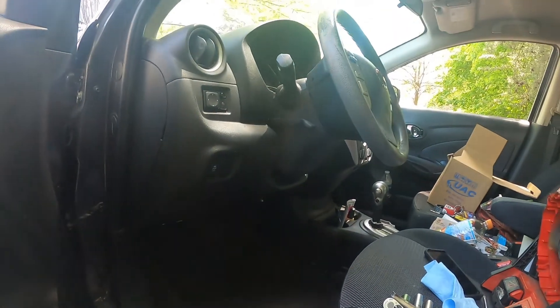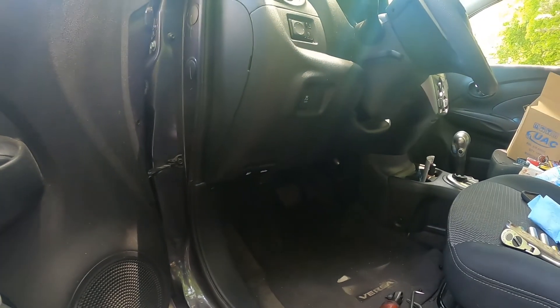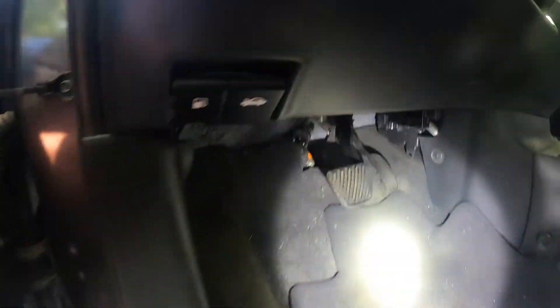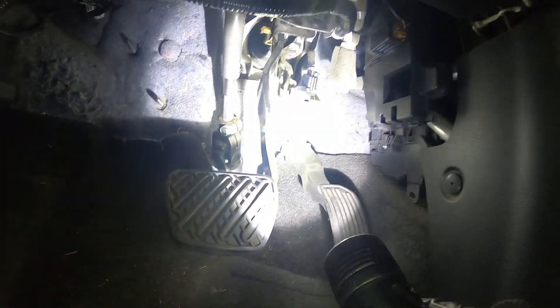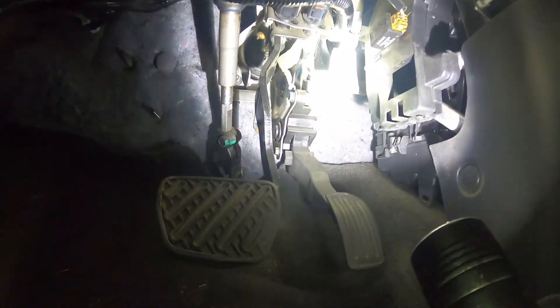Welcome back to Kevin's Mobile Repair. We've got a 2013 Nissan Versa and we're doing a blower motor. I'm going to show this one in multiple stages because I'm not going to be able to get the camera where I need it. First of all, it's on the driver's side — you can see it way up there. All this stuff's gonna come apart, so I'm going to take off the accelerator pedal and the brake pedal — it's gonna be moved out of the way in order to gain access to it up top.